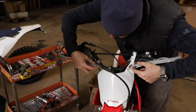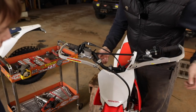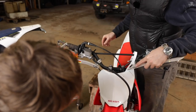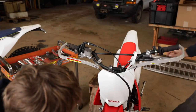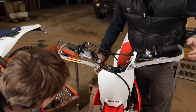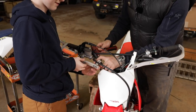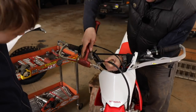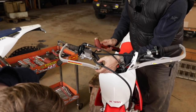So you see the reveal on the two ovals here? They're about the same. They're not about the same. Really? Yeah, this one's twice as much as this one here. And so what do we need to do to make those the same? This is fixed, right? So what's the only thing we can move? We need to use, it's hammer time. Yeah, so we'll use a brass hammer here. And how does that look? That looks pretty close to the same.